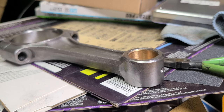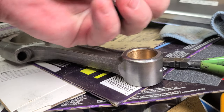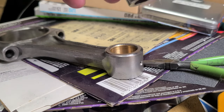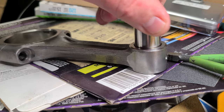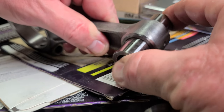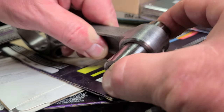I'm going to go grab a wrist pin. Get it lubed up here — I don't want to run it in dry. We don't want a hair in there either. It feels pretty solid. There's a very tiny, tiny bit — barely feel it going up and down — and side to side, no play at all. So I'm happy.